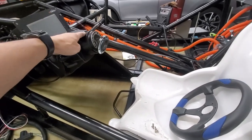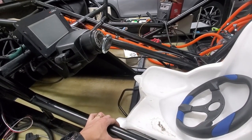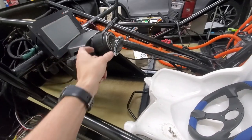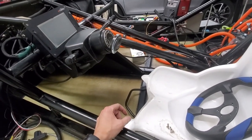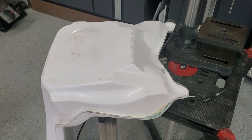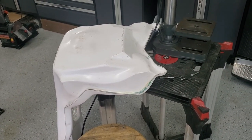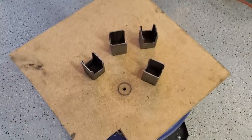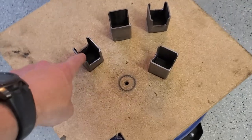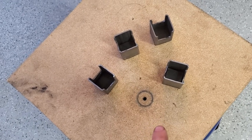I'm going to go back to my other steering column adapter because it is really difficult to get into the car with the steering wheel. So I'm going to go with a removable steering wheel — that short adapter will work well, and I need to get a quick release for the steering wheel. Now working on the passenger seat. I'll go ahead and drill holes. The only difference is I'm not going to have the adjustable rail — I'm just going to mount this one kind of all the way back in a fixed position.